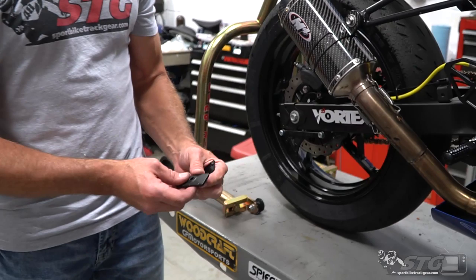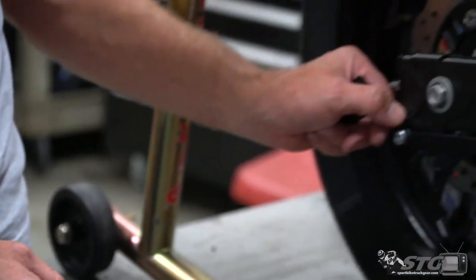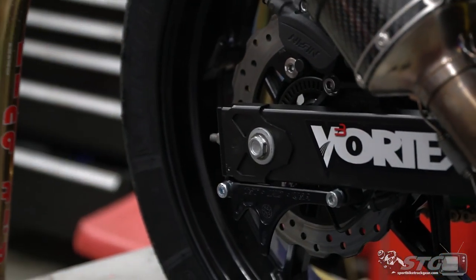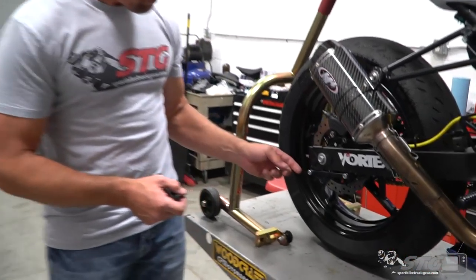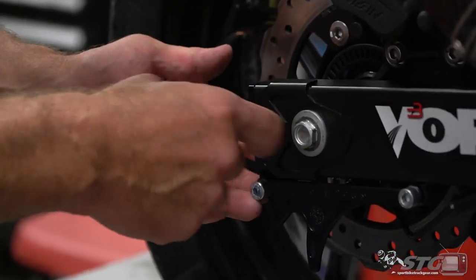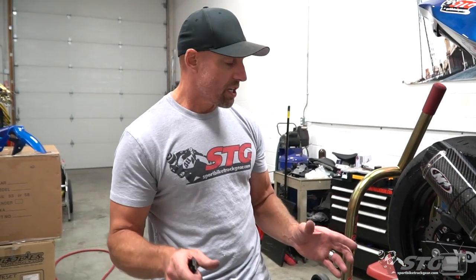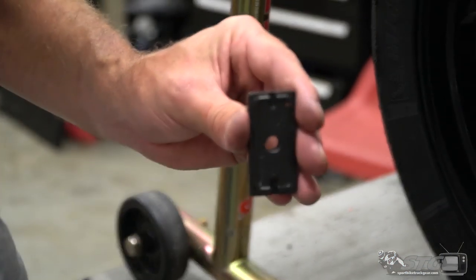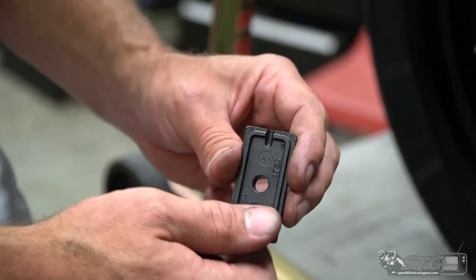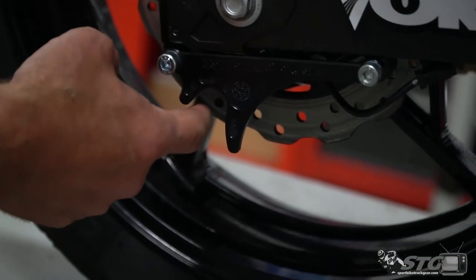What I did previously — as you can see here, kind of kitty corner from each other — I drilled a very small hole in the swing arm and put just a little safety wire in there, and that worked pretty good. These no longer fell out. Inside the swing arm itself, you still have a lot of play with the adjuster, so it would slide back when you throw the axle through — that's kind of a pain. This kit comes with new end caps that simply have longer shoulders. You see how short that shoulder is? That's why there's nothing to hold it in there — they just literally fall out.